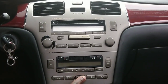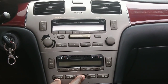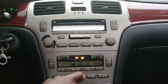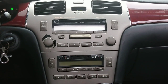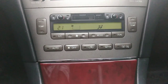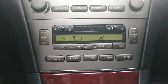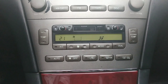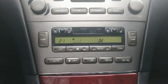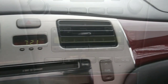As with many computer systems, you could get a false positive. If you are performing the test in the dark, in a garage, or when the sky is overcast with either clouds or shade, it is common to get a 21 and 24, which are the solar sensor circuit codes for the passenger and driver's sides, respectively. If this happens, especially when no other codes are present, re-perform the test in the open under direct sunlight to rule out the chance of false positives.